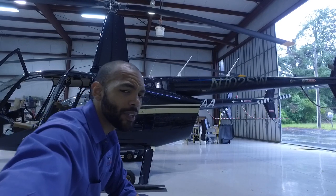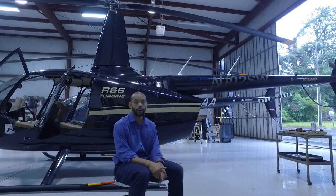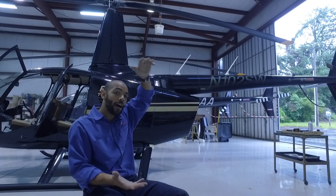One man can do it. There were 10 screws total, 5 on each side. I like to have a roll-around cart specifically for taking the aft fairings or aft cowls off the R-44 and R-66 helicopter. I can rest the bottom of the fairing on my knees and grab the top and the bottom, and roll back very slowly while I kind of work it loose.